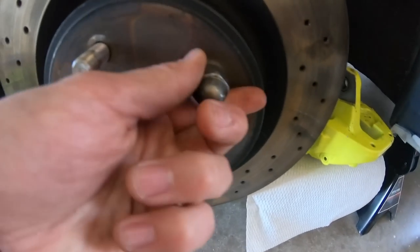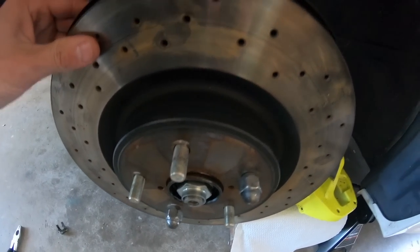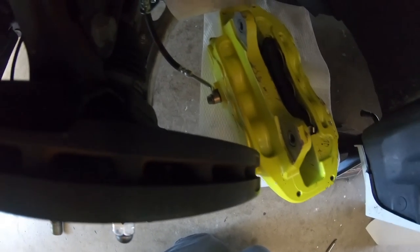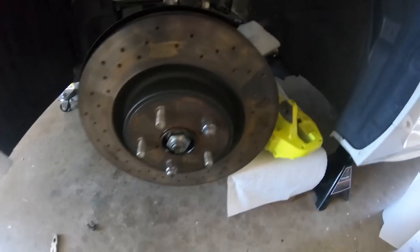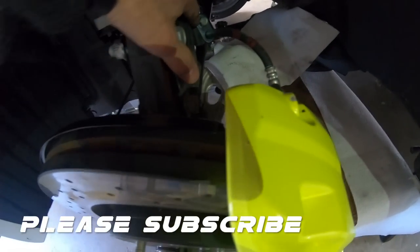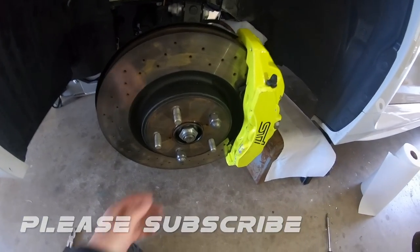I just put my lugs back in here and wound two of them together to get the rotor mounted in the right position before I seat the caliper. Throw those 19mm bolts in, do those 19mms - it's all mounted up. Then finally just come back, put your brake line 12mm on there, and your first side is done.